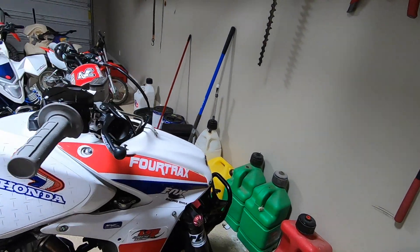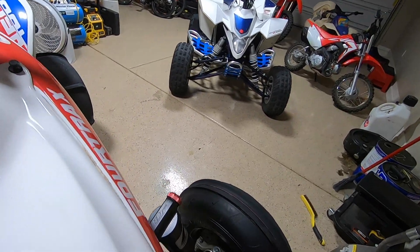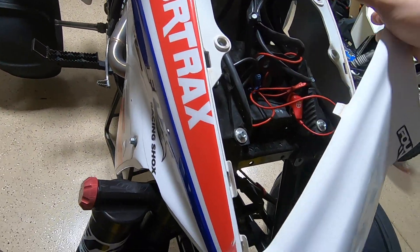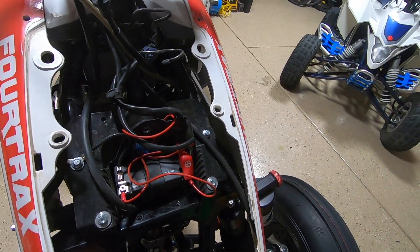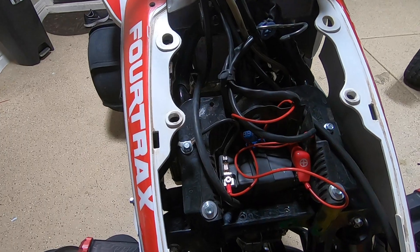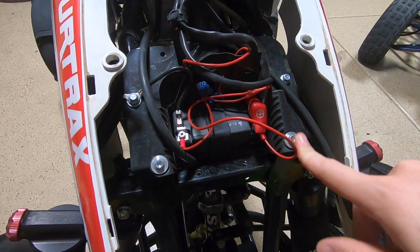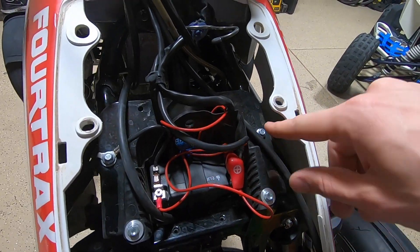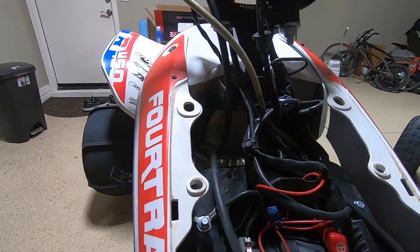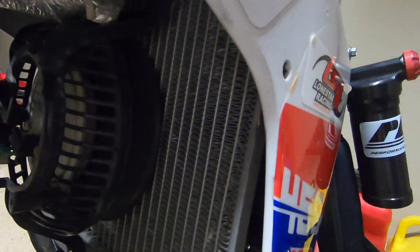Something interesting up at the front — we'll pull the cover for you here, take these little pins out and show you what's under the hood. As you can see, the battery is relocated under the hood for the CRF. It's just the stock CRF battery. You can see some of the wiring here. This is a fan switch — that's what these wires are for. This is actually the Walsh battery holder. It looks pretty clean. All the old ECU and everything is no longer here. The fan switch is just an on/off switch for the fan manually — it's the stock TRX450 fan.